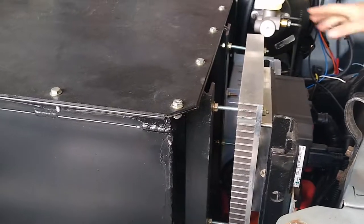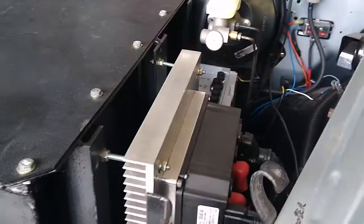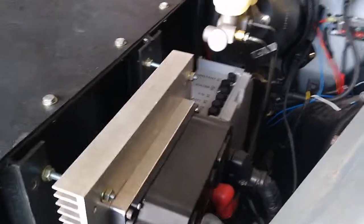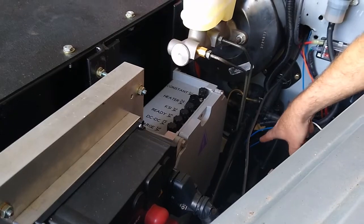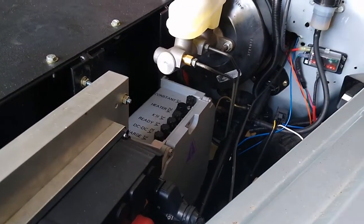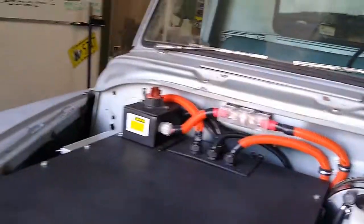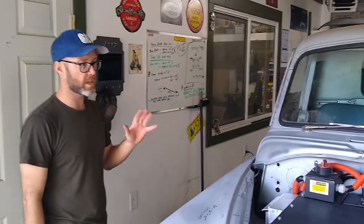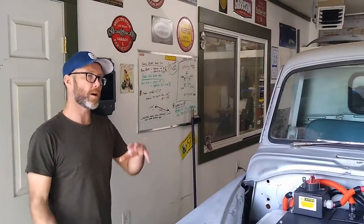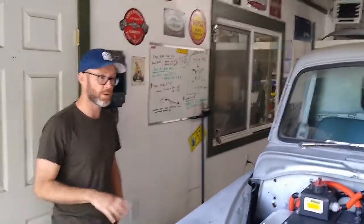Doogie from the restoration shop fabricated some nice brake lines, so we've got four fresh brake lines to the brake system, and a Wilwood proportioning valve hidden down at the bottom. If you go around to the other side, you'll get a peek at the power brake system. These 1954 trucks didn't have power brakes, so one of the big things I wanted was to amalgamate the Ford Ranger power brake system into the old Fargo.